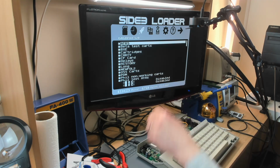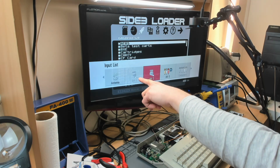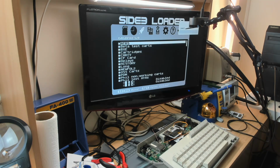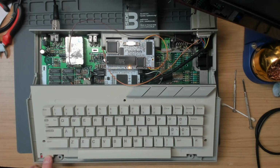We do have that audio buzz, which you can probably hear actually, and I think that's a grounding issue. I'm hoping that when I refit this cable a little bit, because there's a lot of missing grounds. There's so many missing grounds on this cable that on the OSD here, that SCART cable should be coloured in, and it's not even managing to trigger the cable detect on the display. So the cable needs fixed. All this wiring needs to be redone. This cable's got new mylar, and the power light is intermittently working when I push on it. So I'll have to fix that as well.